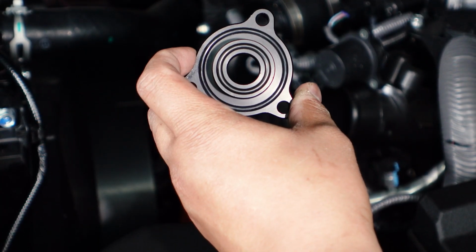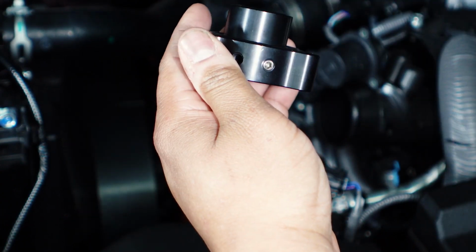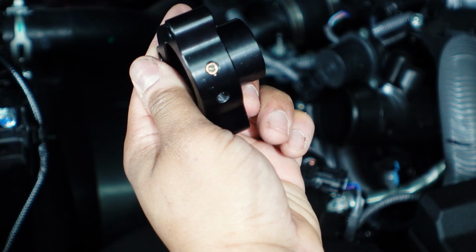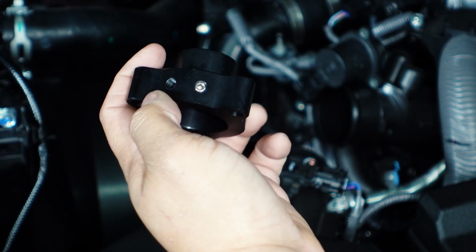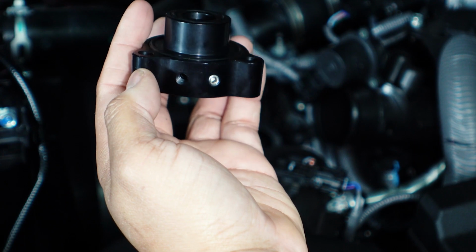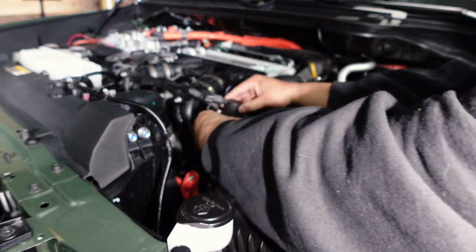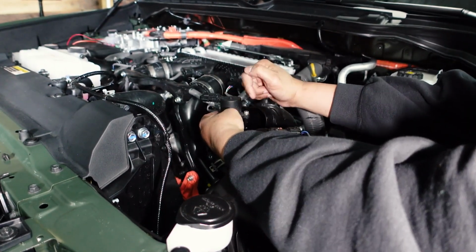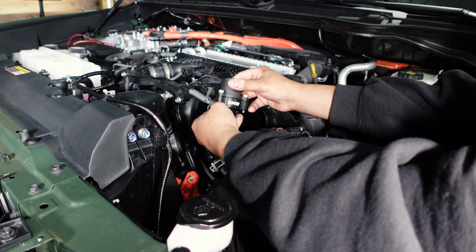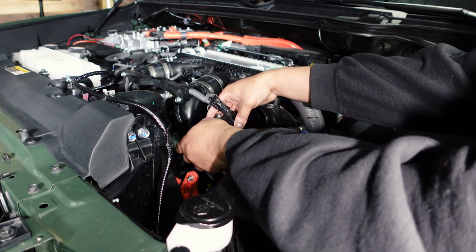We have attached the O-ring onto the blow-off valve, and we are gonna start with one Allen on this side, and on this side, one Allen as well. The instructions that I found online basically said start with two, and so there's four options. And online I've seen people have engine issues when they started with none. So we're gonna start with two and see how that goes. What I wanna show is we did logo down, switch kind of facing towards the fan, and everything is kind of threading through with the new Allen. And there's really only one way you can put this on, so you can't mess it up. Just try not to drop anything in there, just take your time.